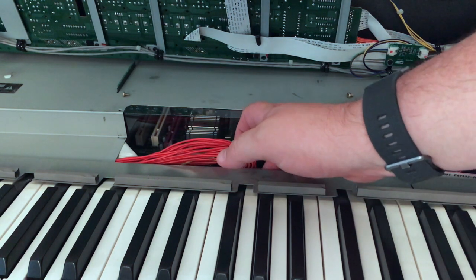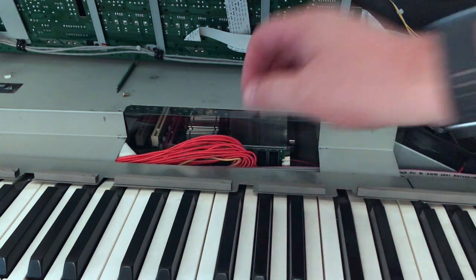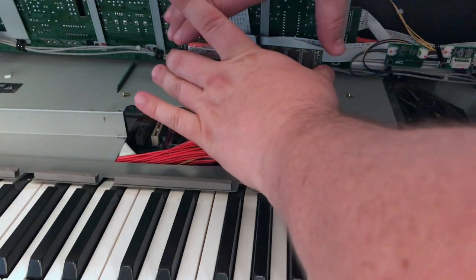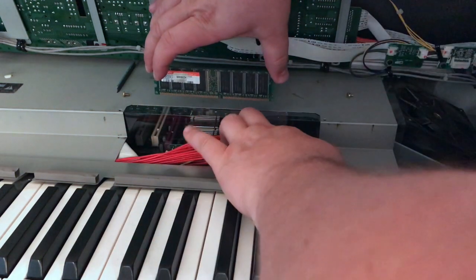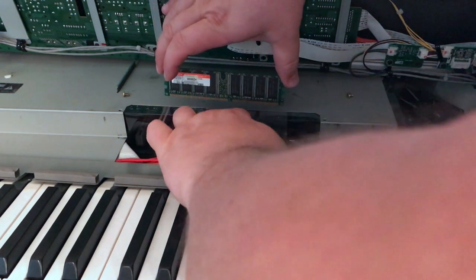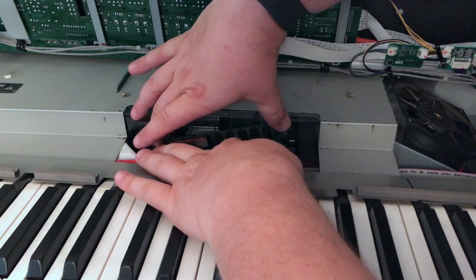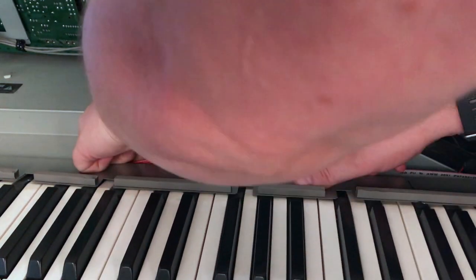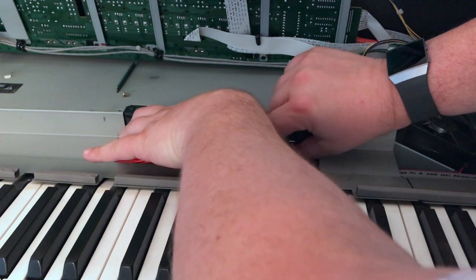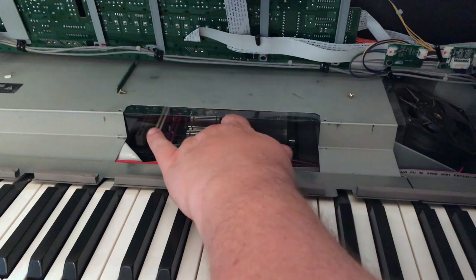Now I'm going to insert my second gig of DIMM into that same slot. It seems to be that that is the way around it needs to be. So as we go in there, let's move these white tabs backwards. I'm sorry, but there's not an awful lot of room in here to get the camera in. And then we just push it home — right way round. It just takes a little bit of force to push that down.